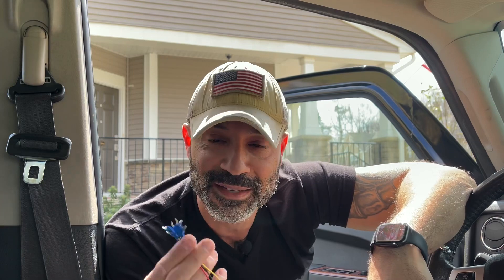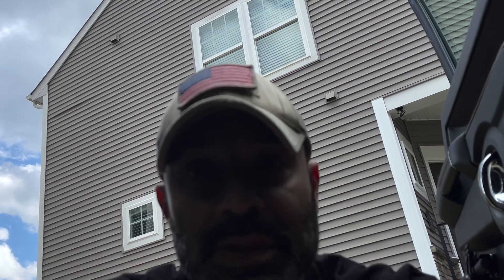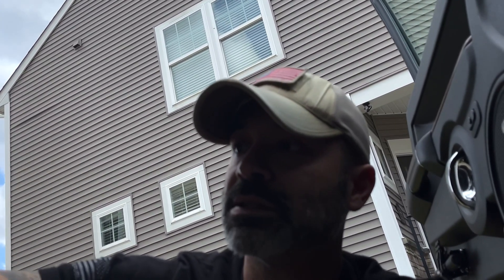What I don't want to do is run this through the firewall and into the fuse boxes in the engine bay. Number one, it's hard to find a grommet without damaging these connections right here. Number two, I don't want to make another hole if I can't find a grommet. I had to look online for the fuse layouts for the Commander because I don't have an owner's manual — it didn't come with my Commander when I bought it. Definitely don't want to take out anything important. If I did have to remove something, it would be something I don't use. Obviously, stuff like airbags and ignition I definitely want to keep in there.